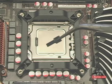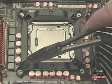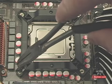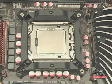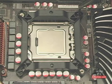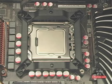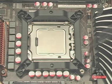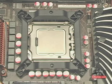Next I'll get a grip on the head of the black spreader pin with my pliers and push it straight through the white, arrowhead-shaped pin. I'll do the same at the opposite corner from the first, and then the final two. The mounting plate is now secured to the motherboard.